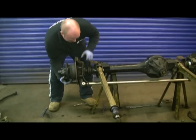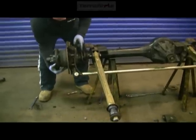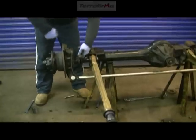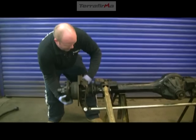So we've done the bolts round there, pulled them out, and now what that does is that allows that to move like that. So if it doesn't come off the end, we'll just get a hammer and a chisel in there, knock it, or put a block of wood on there, beat it, break the seal — it'll just be a gasket seal. Anyway, so then you're out of the dip.